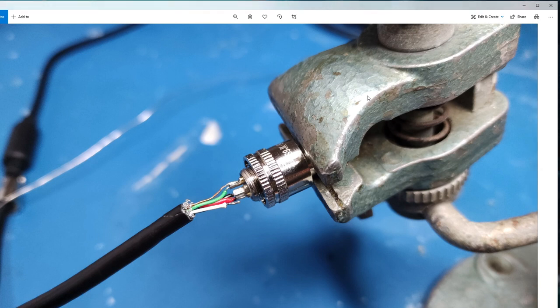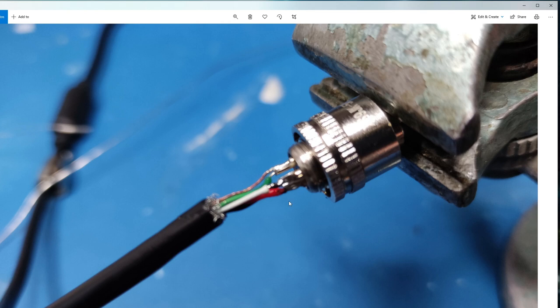I'm using this little PCB clamp I have lying around - it's probably about 35 or 40 years old but still works grand - so I clamped this to have something to hold the connector while I work on it. I put a little bit of extra solder onto the bucket where the wire is going to go, then hit the bucket with the iron and pushed the wire onto it. Sorry this is slightly out of focus. There's only about one to two millimeters of the actual wire making contact on there, but it's good enough.